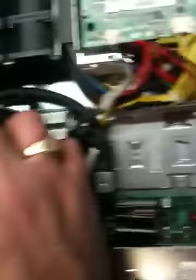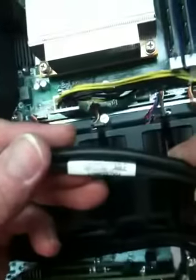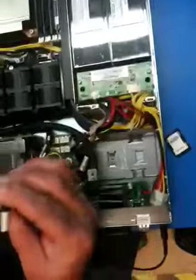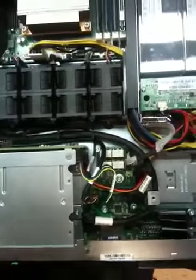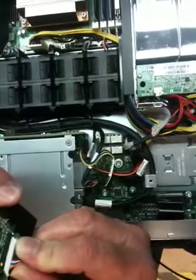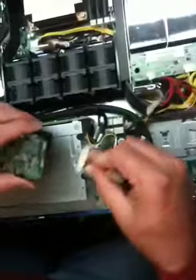The super cap looks like this. In the cable kit you're going to find cable K00878-001 — the smart super cap cable. Attach the cable to the module before it goes in the chassis. The cable installs with the contacts facing up. It's keyed so one end goes in here and one goes in the other, so make sure you get the right end. Contacts up.